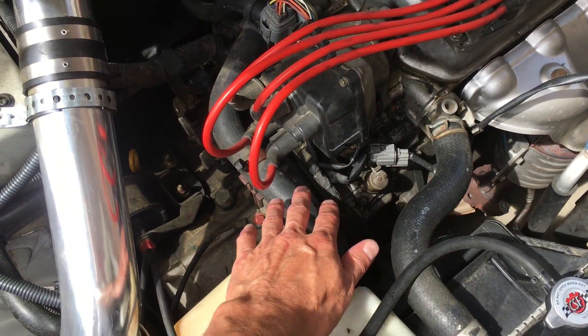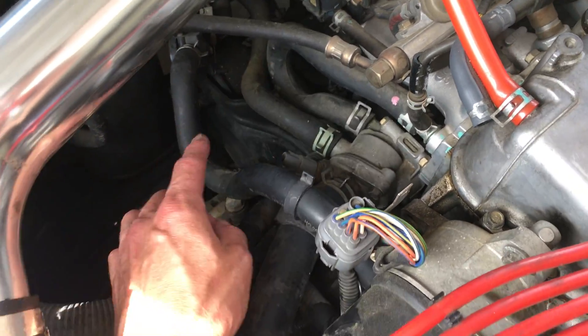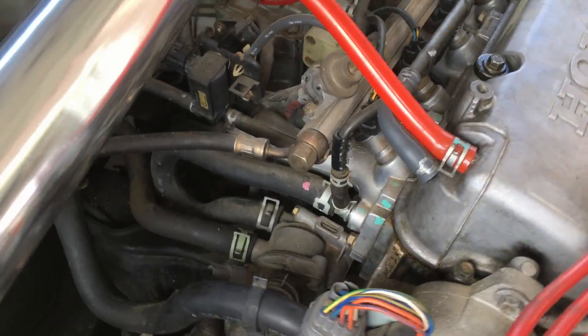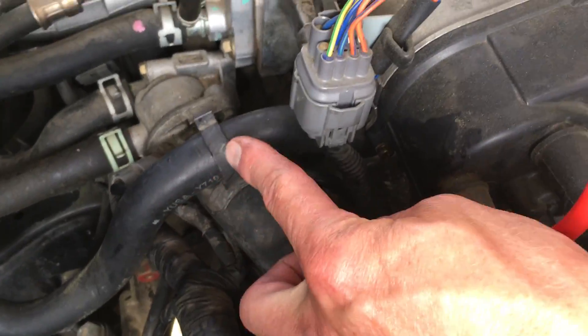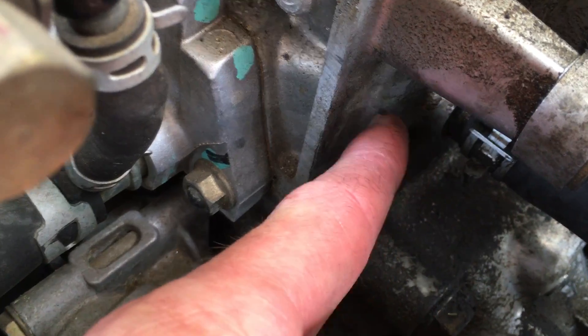You've got all these different hoses that could be bad. There are kits where you can order every one of these hoses. But this hose in particular is the one, and it's hard to see. It's right here underneath the distributor — it curls under and goes down right under here. You can kind of see right there, there's a clamp on it right here. This hose was leaking, and right here where this clamp was, right after the clamp there's a nipple that comes out. About an inch and a half out was a hole in the bottom of that hose.